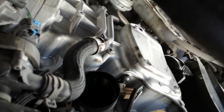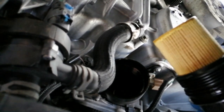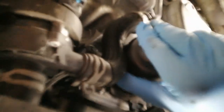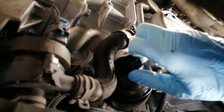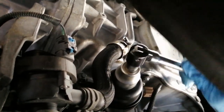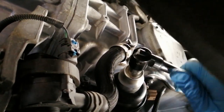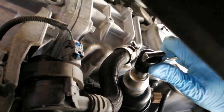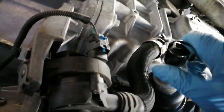As you guys can now see, there's barely any oil coming out of the sump or the filter — it's all drained out after I've given it a while. We're going to get the new filter, the housing nice and clean, and put this on the hose there. Go into place, move the hose out of the way, and then snap into place. Then just twist this on and do it up. I don't worry about torquing it — you can torque it if you want, I've got no idea what the torque settings are. Just do it until it feels tight and then just nip it up. Don't do it too tight because you might snap something. Once it's tight, that should be fine.